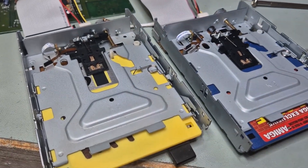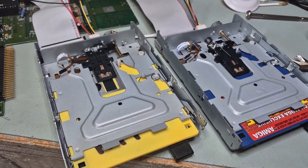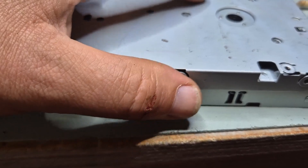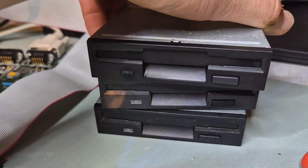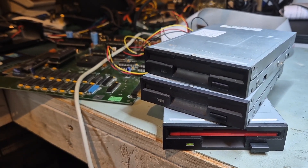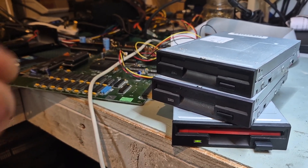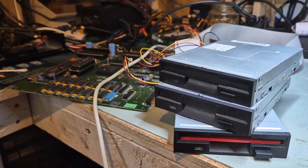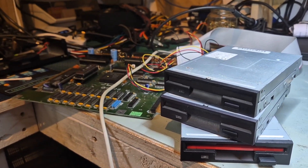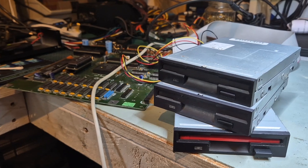As you can see, we're working. And that's three drives — I'm going to put these back together. That's three drives cleaned, restored, and modded for Amiga. They mustn't have been working before because one had issues with the head alignment, one had the missing track, and the other one had a problem with the ribbon connectors. They're back working, they're now modded. And it's a simple mod — it's just two jumpers, one cut trace, and one little blob of solder, really.